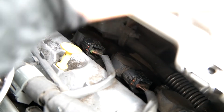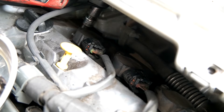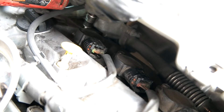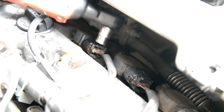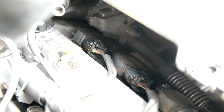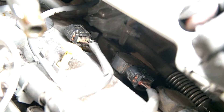I'm going to start from the right side and work my way to the left. This is the one you have to do very carefully, otherwise you'll strip the thread. If you want, you can unclip these boots — just make sure you know where they go. Right now I have some oil here, which means my valve cover is probably leaking and I'll need to replace that too.